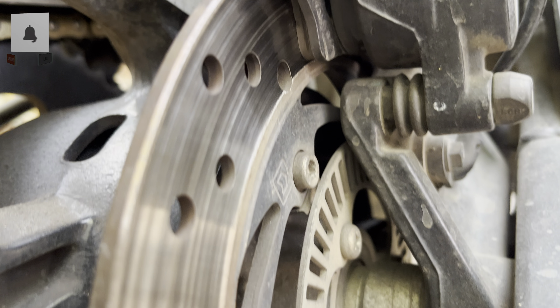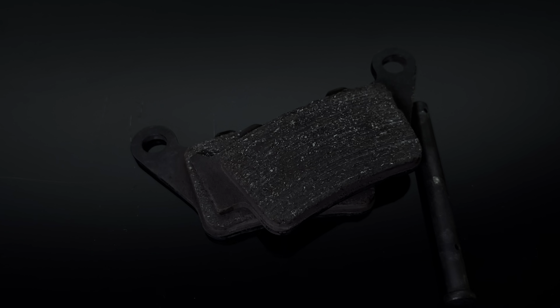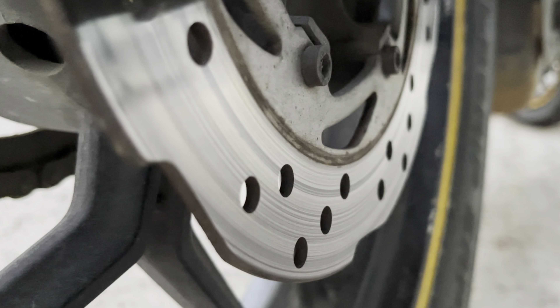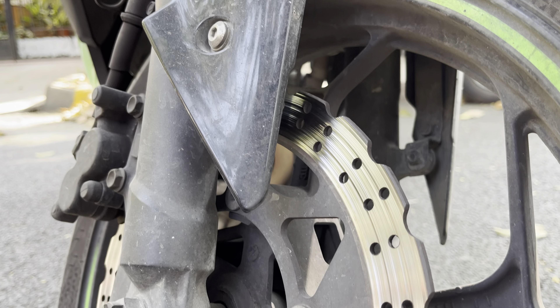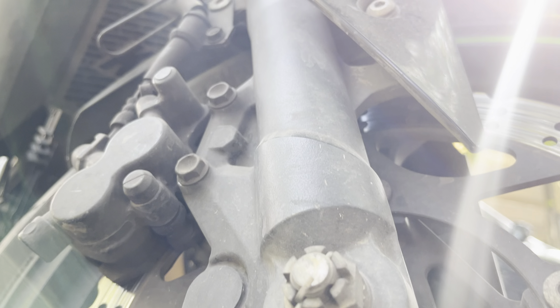While sintered brake pads have their pros, there are some cons to consider. The first is price — the cost of sintered brake pads is very high depending on different makes and models. Being a metal brake pad, it is also one of the noisiest. The metallic particles or brake dust generated tends to stick around the brake calipers, making them very difficult to clean. One major con is that sintered brake pads affect the brake rotor over the longer run, since both the rotor and the pad are metallic, causing higher wear and tear on the rotor compared to the other two brake pad types.